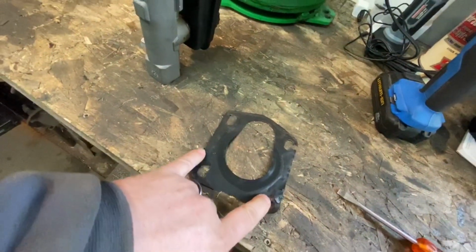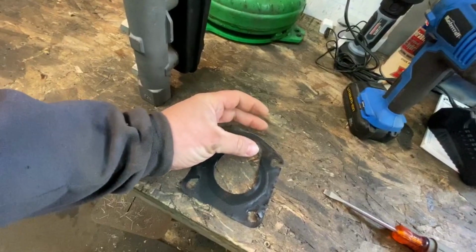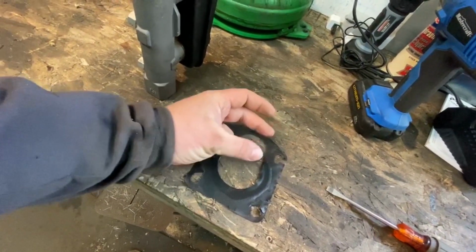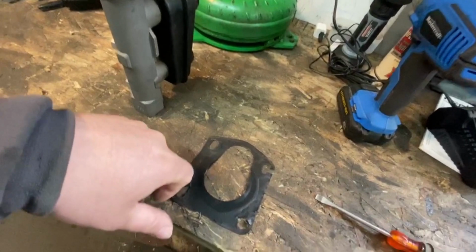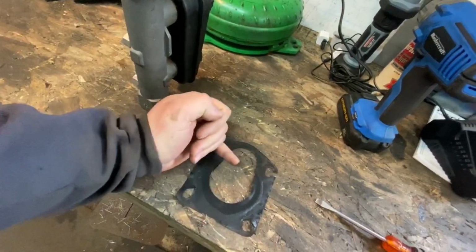That's okay. I'm just going to make my own plate that will use the bottom or top. I think I'm going to mount this master cylinder towards the top of the hole in the engine bay. That's for the pedal ratio. If I used the stock location, I don't know if I would have enough leverage to produce what I need. So I'm going to move it up.